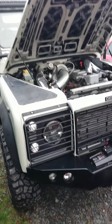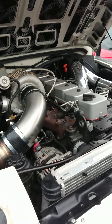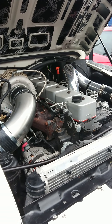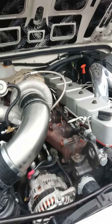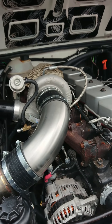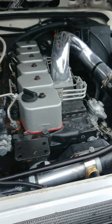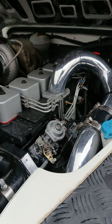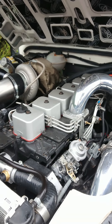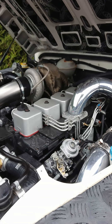This is just a quick video on my Cummins powered Land Rover. It's a 5.9L 6BT out of a DAF 45 lorry, coupled with the DAF gearbox which is a ZF-S542, which is then coupled to the Land Rover transfer case via an adapter kit by Rhys Myers. The engine itself came from the lorry with about 200,000 miles on it. I rebuilt it and put it in the Land Rover.